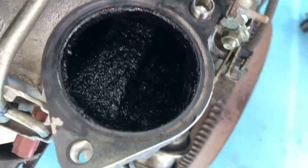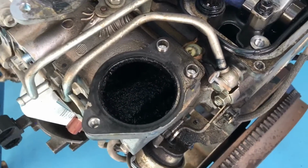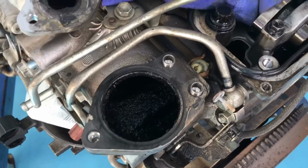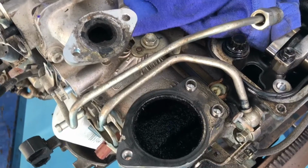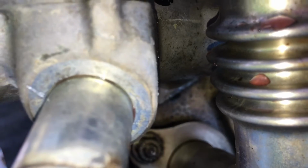What this looks like is an intake system of an engine that's had a remap and they haven't cleaned anything, right? So they haven't done the basic recommended preventative maintenance. And they've gone ahead and done a remap and shut off the EGR, because for it to be that clear, that looks like it's got a plate in it, but I don't think it has, it just looks non-operational. Let's have a look what's going on down in here. Yeah, no, don't think so. Don't think that's ever been touched. I don't think any of this has ever been cleaned.